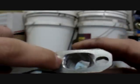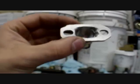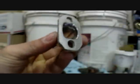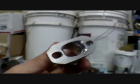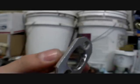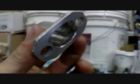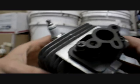Cut it out. After you cut it out, line it up on here, take a Sharpie, outline, trace what size that is, and then grind it up according to that size so you can match it up. That's what I did, and it worked really well. Matching your exhaust port will allow your exhaust gases to flow through a lot better, more efficiently, giving you better power and better thermal efficiency. So there's going to be less heat buildup, therefore making more power because there's less friction and power loss from the heat.